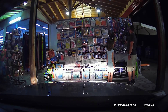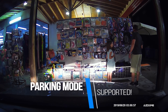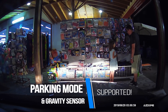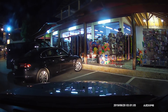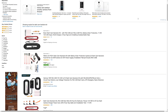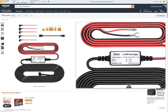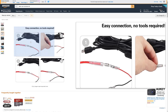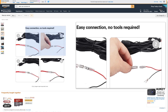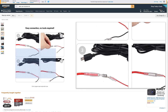I mentioned the parking mode — that means you can have the camera recording events when your car is not powered on, during the night for instance, when the camera is not in active recording mode. Using the motion sensor, the AZ Dome dashcam will notice any movement happening in front of the car and record accordingly. If you count on the embedded battery, this can record up to 20 minutes of footage. If you need a more reliable solution, make sure to add a hard wire kit — most of these are dirt cheap nowadays, usually no more than $10 to $15, and easily connect to your fuse box. Even for a non-technical person, there's a great chance of getting the installation successful.